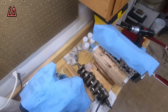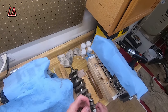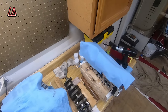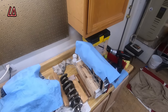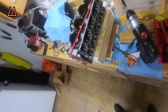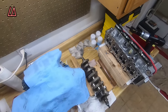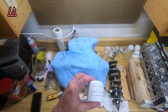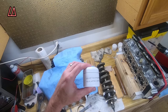I'm going to put my head back together too. I've got the new valves and all that, and I've lapped all of the exhaust valves — and you can't lap titanium valves. So I'll probably just polish them up and then put this whole assembly back together. She's all cleaned up. I used this lapping compound and lapped them all the way up to 1,200. I went from 400 to 600 to 800, and then finally to 1,200.